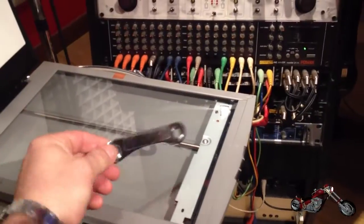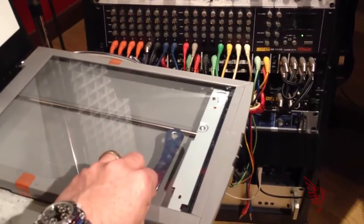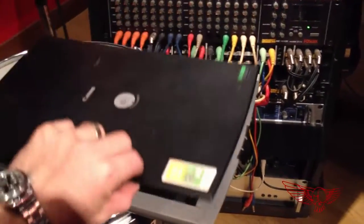The top side will have to have a pocket where we can insert our copper part with the logo design. So, let's get started. To be able to design the new part we have to digitalize the original one, and to do so I usually start by scanning the part and importing the picture into a CAD software where I then can make the design out of polylines.